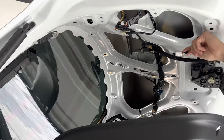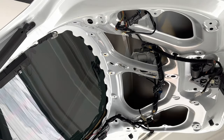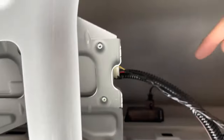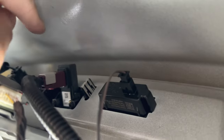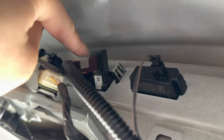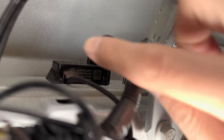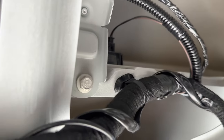It's this white wire here. Next, unplug the license plate lights — one on each side. In between them, there's a plug for your camera — unplug that. Make sure your vehicle is off, then you can push out the lights and the camera before installing the bar light.